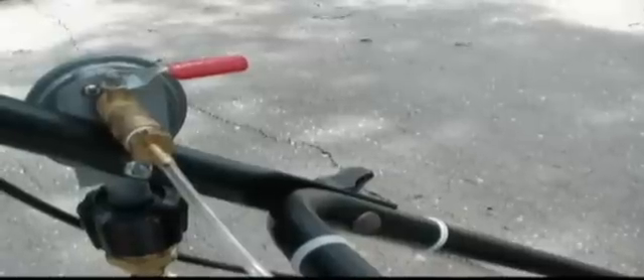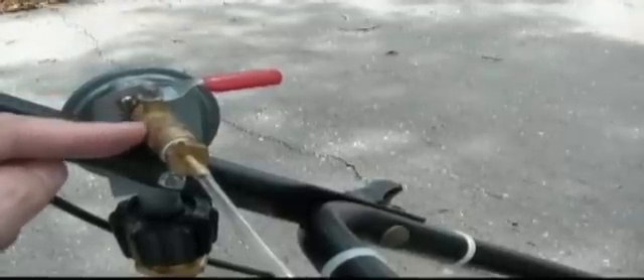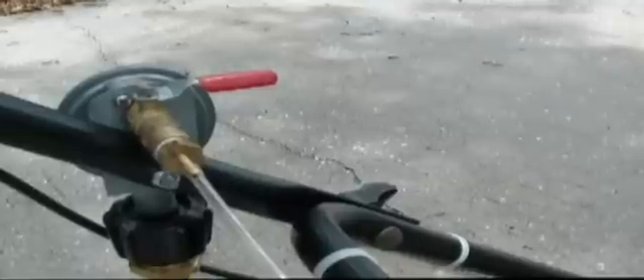I found that wasn't really necessary. I kind of found that out by accident, because originally I didn't have my ball valve tightened internally and it was actually leaking — I couldn't turn off my lawn mower. So I experimented and found there's really very, very little flow that has to come through here. Just a little bit of flow is enough to keep this lawn mower running at full power.